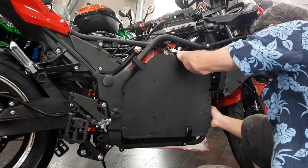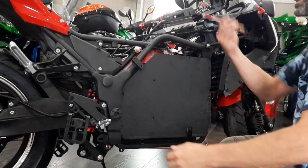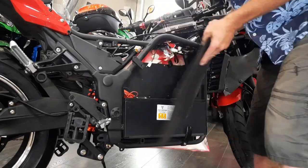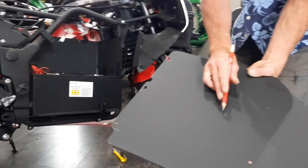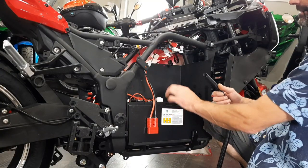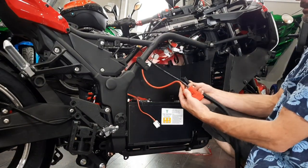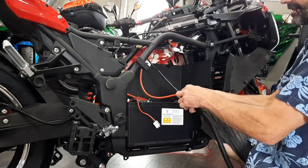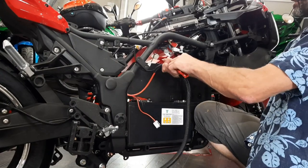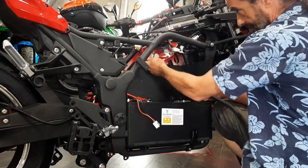Line up your holes — you can put a couple of screws in here if you're not 100% sure you're lined up, then reach inside with a pencil and mark your other hole to drill. Drill another quarter-inch hole there. We've drilled the hole in the other panel so we'll leave this in. I usually put some wire loom around these — it protects them, especially with this one going over the metal edge. Just a little loom to keep things neat and protected.